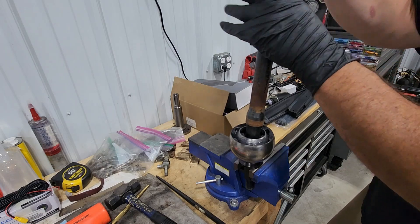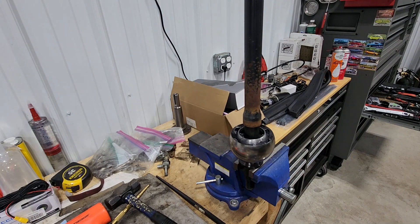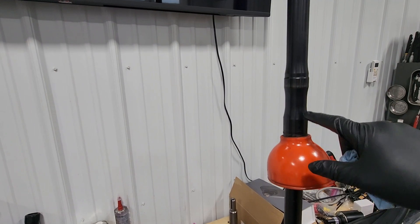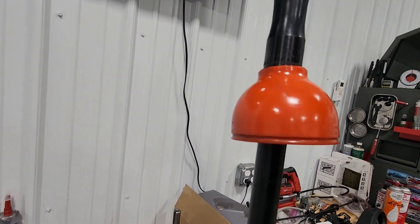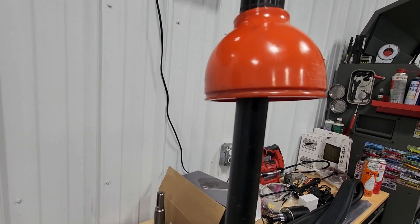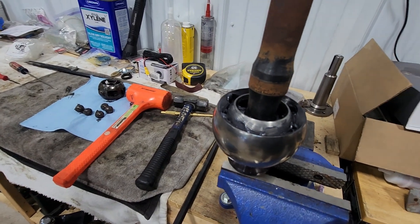And that's it — that's all there is to rebuilding your RCV axle shafts. Now you can either reinstall or put them away, however you need to do. The boot will have to come off the shaft to go in — it's going to take quite a bit of work to get it over this here. You just got to put some lube on it and you might even have to tap it with a hammer. Unfortunately, to get this in a JLJT, this boot has to come off because you have to put this inside the knuckle and then slide the axle shaft through it as you're putting it into the axle.